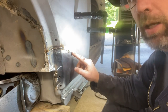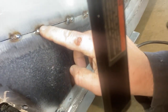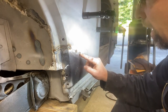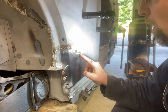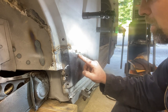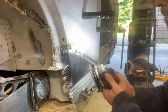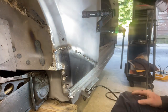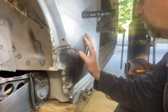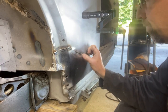So I'm going to re-grind this weld off here and see if I can pull this upper surface out a little bit. Otherwise I'm afraid when I grind this smooth, I'm going to have to grind through too much of this lower surface. So I'm going to grind this one back open. That actually feels better already — let me see if I can use it.